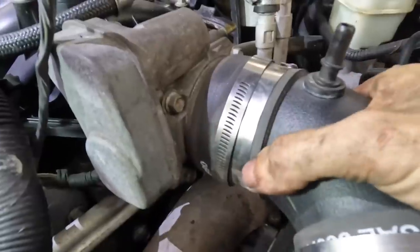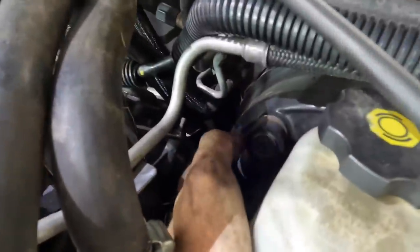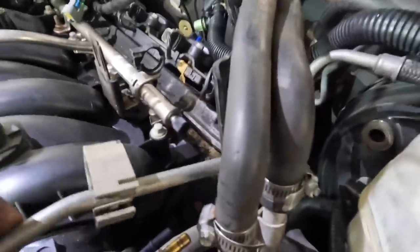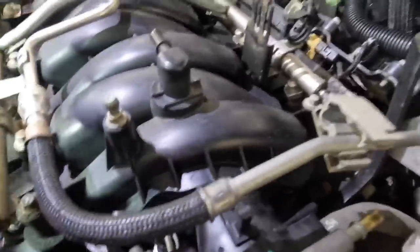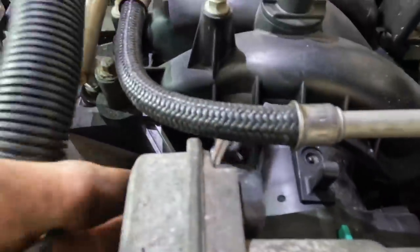Pocket screwdriver — let's see what we've got to do next. First things first: is there coolant running through this throttle body? Because if there is, I'm going to take the throttle body off. I don't think there is. Big old vacuum tube — take that off right now. That's how you know your brake booster is good — it held a vacuum, and the check valve held the vacuum. Got all the support equipment removed except for this little connector right here — that's going to be fun. That's a coolant temperature sensor I believe.